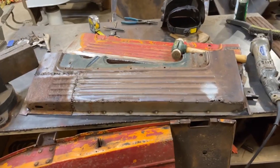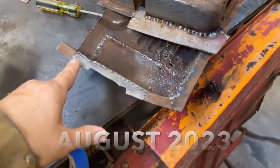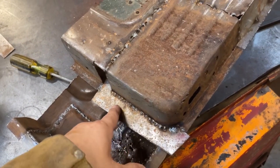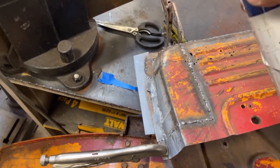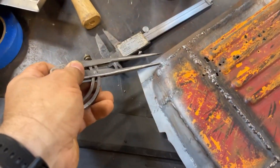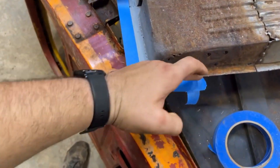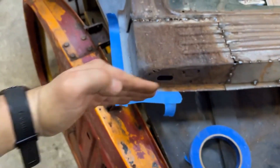Where I left off about 14 months ago was these door bottoms. Job number one for the evening is going to be using tape to capture this edge profile and reapplying that tape over onto here to use as a pattern to cut out a new edge. The tape didn't really work out, so I just clamped them together. Clamping together didn't really work out, so now I'm on to plan C — I've got some points here and I'm going to be measuring and scribing off of that to transfer some lines. Using the divider to get both of the proper widths on here and the bottom, using the tape to bring them to a nice point based on their overall angles — and now I'm going to cut them out.